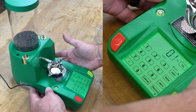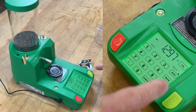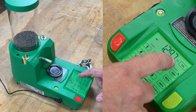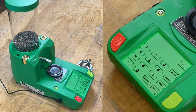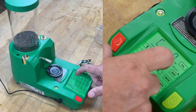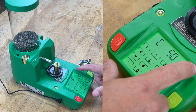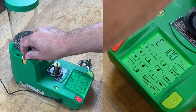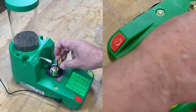Let's do the first important thing: calibration. We want to remove the pan. If you're in the app, it's going to tell you to remove the pan. What we want to do is zero and then hit calibration, making sure there's nothing on there. That's our zero weight. Hit calibrate again, throw a 50 gram weight on, calibrate again, throw another 50 on. And now we are good to go.